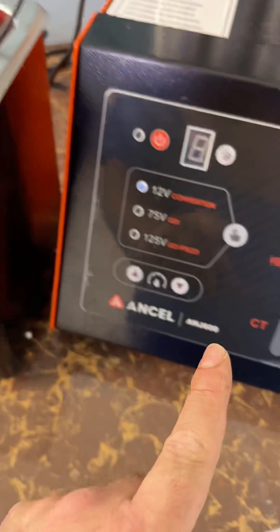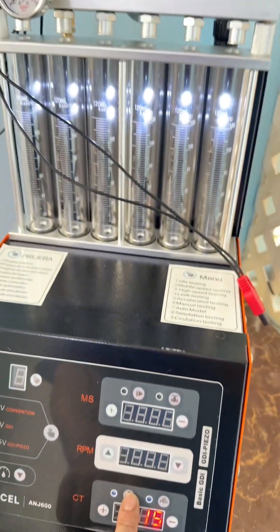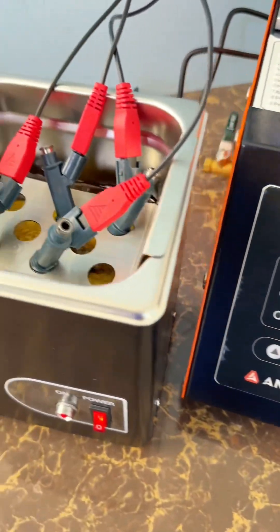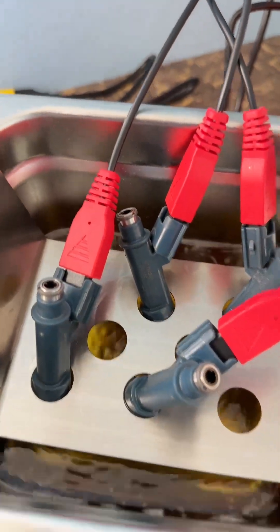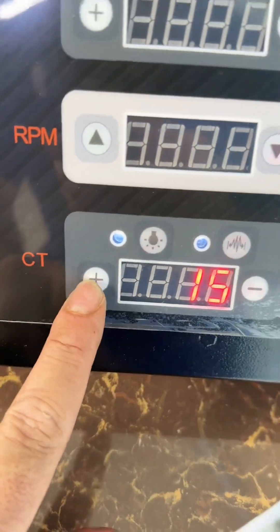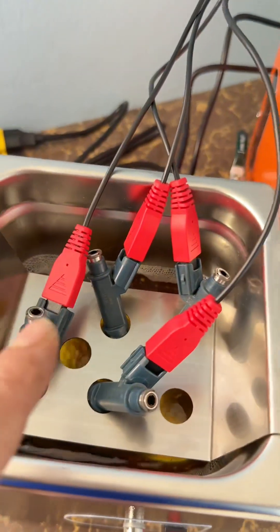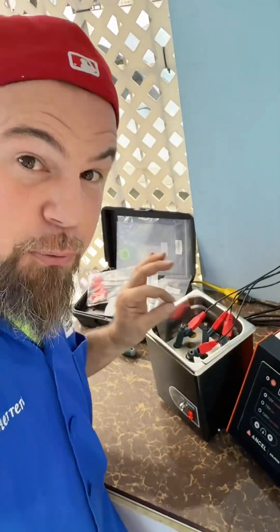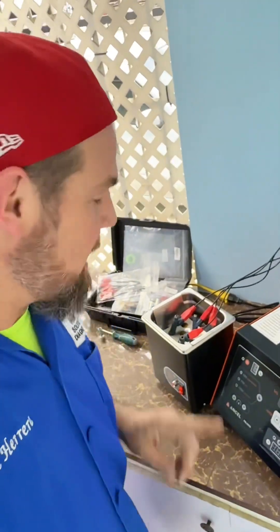She's turned on — let me turn on the light, looking good, and let me start the ultrasonic. That's it, the ultrasonic is doing its job. I'm going to set it for 20 minutes. The good thing is that when you're doing the ultrasonic and she's connected, the machine is actually pulsing the injector automatically.